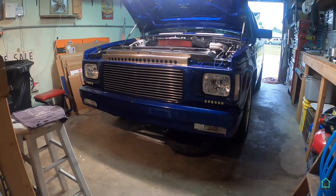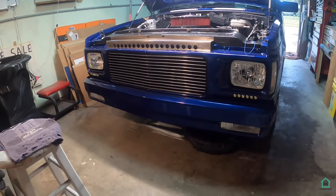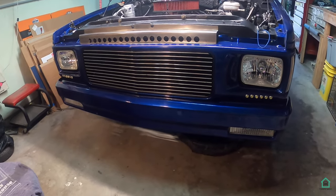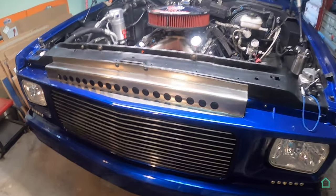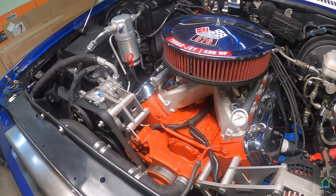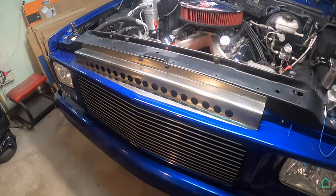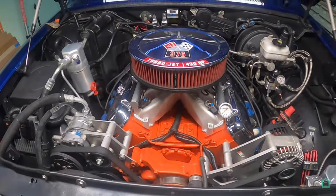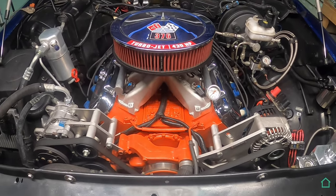And so it begins. Today being day one of this DoD delete kit that I am going to be installing. As you may or may not be aware, a lot of stuff has got to come off in order to do that. I mean, to replace the cam, all the front of the engine has got to come off, including the rad, the AC condenser, the grill, all of that stuff has got to come off the front. And then we start taking all the front stuff off, all the top stuff off.